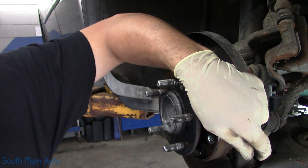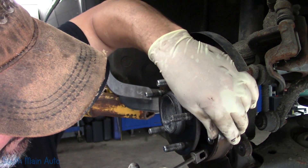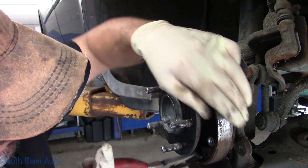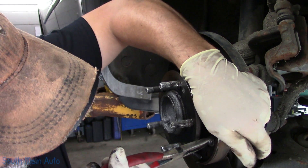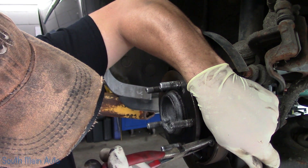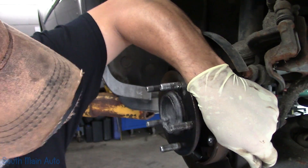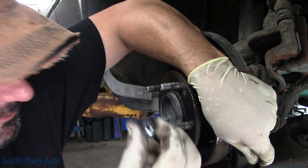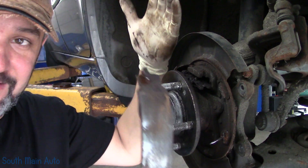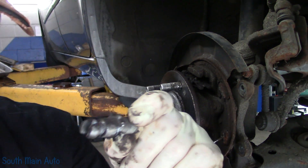Now we're going to take — you can use a cup tool to push in on these cups, but honestly they're a little bit difficult to get to with the tool. So I find using a pair of needle nose actually works pretty good. Grab on the outside of the cup, hold the pin on the back side with your digit. Then push in on the cup and give it a quarter turn. Don't let it go flying because it will get you. Then take the cup and the spring off. Our shoe should be loose — and then the adjuster hits the floor because we didn't take that out first.